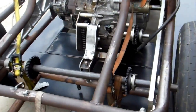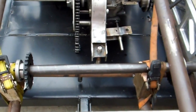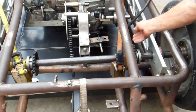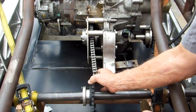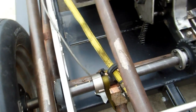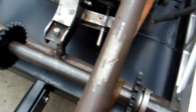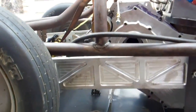Let's talk about the rear end. It's just a live axle. It's going to have two sprockets on it. Each axle that used to go to the tires now goes to a chain, to a sprocket, to a chain. And there will be a caliper over there for braking — single caliper. These are self-centering bearings, pillow blocks.